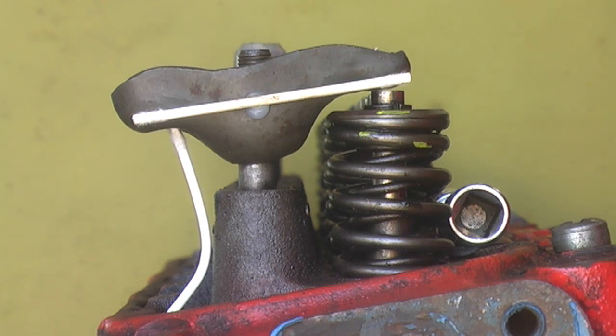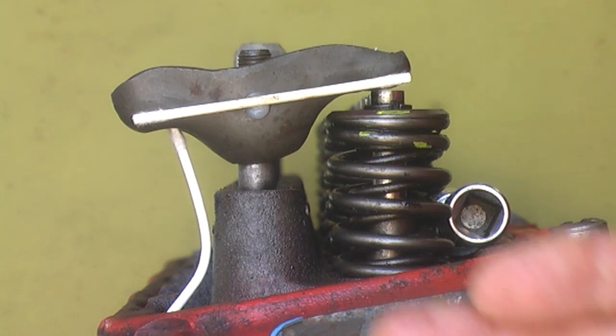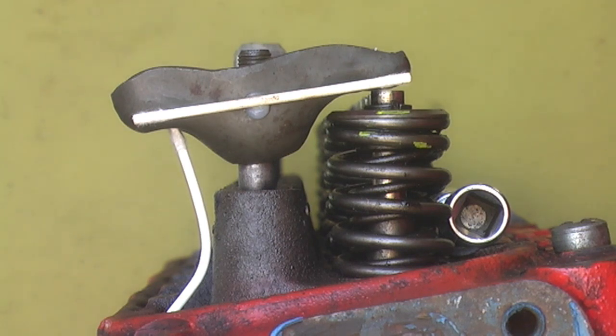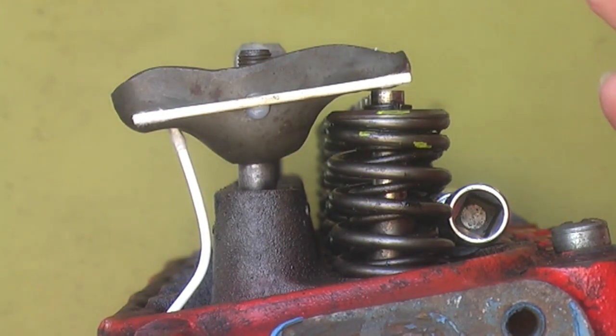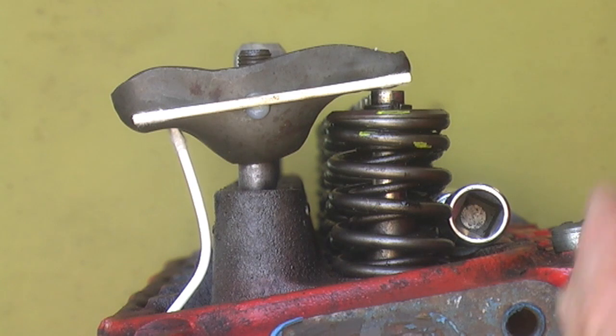I think I've pretty well covered a cylinder head with hydraulic lifters. You can actually screw it down a little bit deeper to restore your rocker geometry to where it should be. At the end of the day, like I did on the 202 head, you're going to have to put a dummy lifter in, simulate that half to three quarters of a turn drop in your hydraulic lifter. Put a dummy lifter in and get a mark across the tip of your valve stem — bearing blue, rotate it a couple of times, carefully remove your rocker, and have a look at the mark and see if you've got it right. This holds true for people that haven't got a head where the stud and valve stem are parallel to each other — that's the test you would run to check your pushrod length and see if your adjustment is correct.